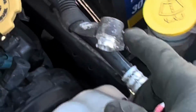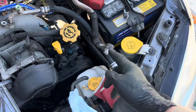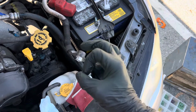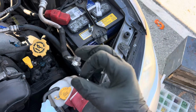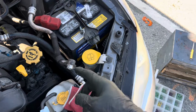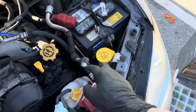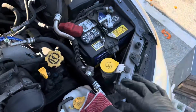This does two things. One, it's a lubricant, so you don't damage your O-ring when you're sliding it in. Two, it's an oxidant preservative. It will coat the O-ring, and oxygen won't get to it through the silicone grease. It's also a great sealant for vacuum, and it preserves synthetic rubber materials. So by having a coating of this dielectric grease on your seals, it will extend their lives. So it does many things all at one time.